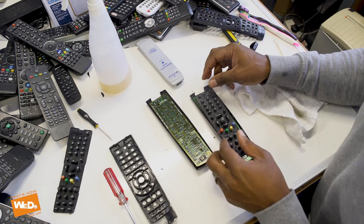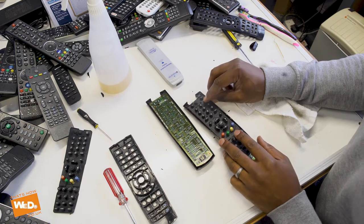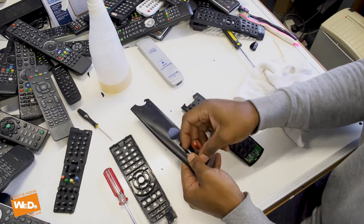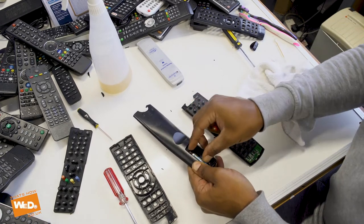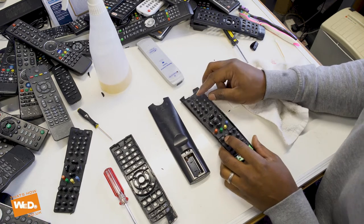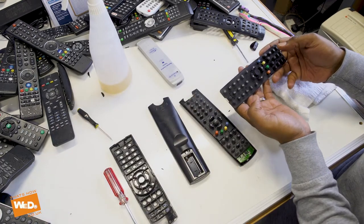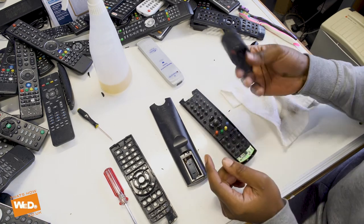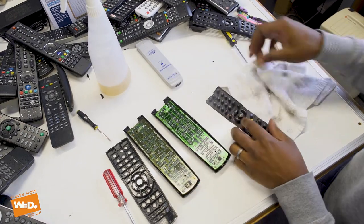Let's try this on our other circuit board just to double check — on/off button. Oh, didn't put batteries in there. Okay, so swapping it — you can see this is definitely the rubber that was the issue. The first rubber from the first remote was definitely the issue, and I don't really know how to repair those any more than that. So I'm going to dash that one out, get rid of it. We know both circuit boards are working fine.